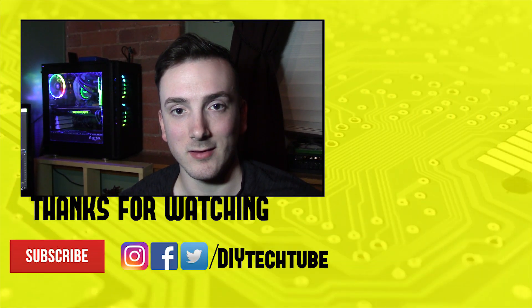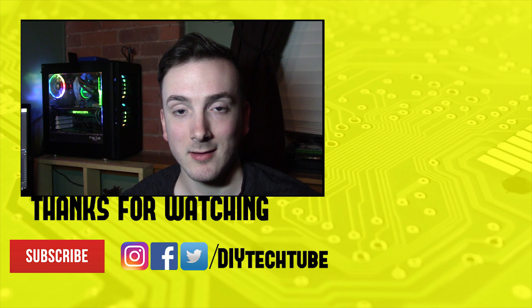I hope this video gave people more confidence when it comes to modding their motherboards. You can totally paint any part — just the PCB, the heat sinks, the IO ports, anything you want — and it won't affect temperatures more than just a few degrees, if that. Just keep in mind the obvious stuff: don't paint connection points or anything under the heat sinks, and use the correct type of paint. The link to the full detail video is in the description. Now you can buy a motherboard based on utilitarian benefits instead of aesthetics, because you can just change the aesthetics yourself. If you're into computer modding, go ahead and subscribe and I'll see you in the next one.